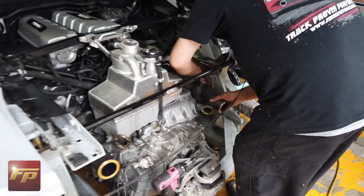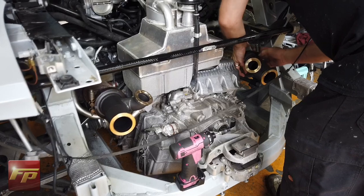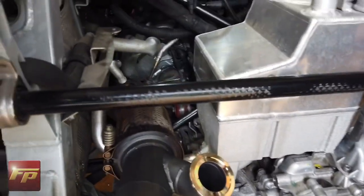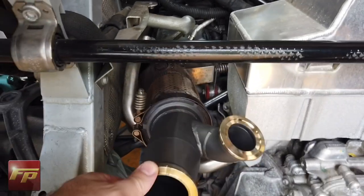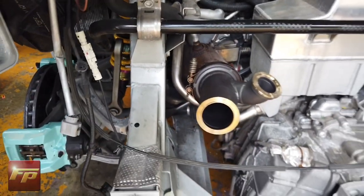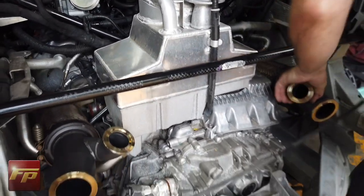In this video we're going to continue where we left off — mounting the turbos to the vehicle, then starting to add intercooler components and working our way from the back of the car to the front. The first step is putting the adapters onto the factory header. You can see it's on a flex joint, so you still get full free motion from the engine to the turbo kit — no worries about cracks. We bolt those on, loosely clock them into position, and then mount the turbochargers themselves.